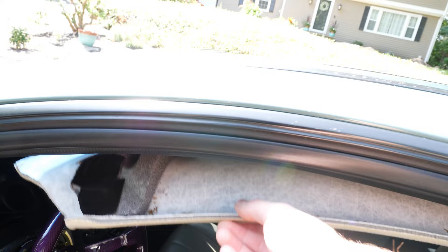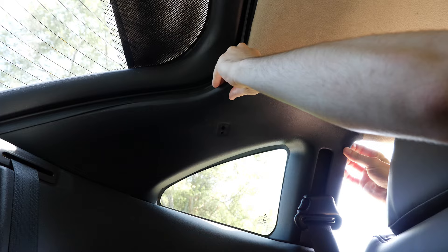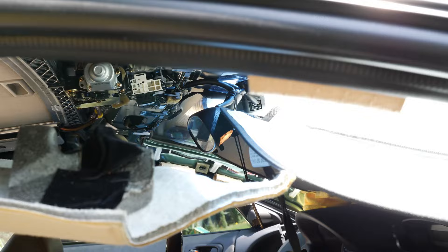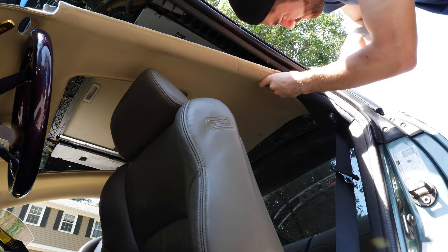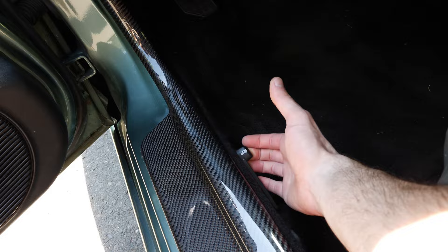The headliner is just being held on by a few small things. If you come to the driver's side C-pillar, this hook needs to be removed — just one Phillips head screw. You don't need to remove the C-pillars to get the headliner out; you simply need to release the clips at the tops of them. This leaves you just enough space to send the headliner forward and let it come out. This part was an interesting challenge, but I was able to do it by myself. Fold your rear view mirror all the way down, then send the headliner forward forcing it underneath it. Then you can pull each side out from underneath each C-pillar — that'll take a little bit of force. With the headliner dropped out from the C-pillars, you can now pull it out of the car. I sent mine back out the rear hatch.